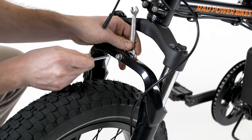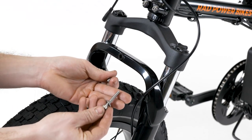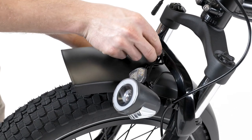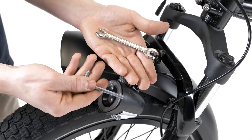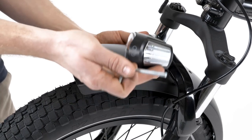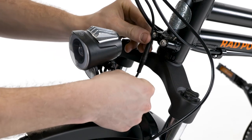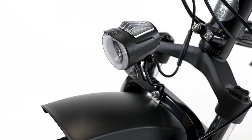To install the headlight and front fender, first remove the headlight mounting hardware from the fork arch using a 5mm allen wrench and a 10mm wrench. Pass the fender from the back of the wheel forwards through the fork arch. Pass a washer onto the bolt, then pass the bolt through the headlight mount, the fender mounting point, and the fork arch mounting point. Install the remaining washer and thread the lock nut onto the bolt end. Use a 5mm allen wrench and a 10mm wrench to tighten the bolt part way. Torque the headlight mounting bolt to 6 newton meters. Plug in the headlight connector, align the internal notch and pins and external markings, and press together without twisting. Center the headlight and adjust the angle slightly downwards so that it will illuminate the ground in front of the bike and will not blind oncoming traffic.